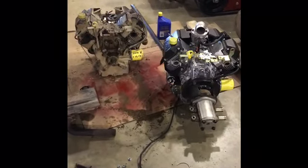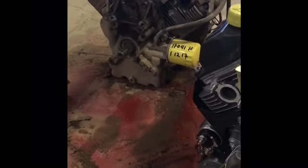On the old engine first, find where the drain plug is for the oil drain and unscrew it. On the same side of the new engine, find the bolt in the place where that drain goes, take that bolt out, and replace it with the oil drain from the old engine. We use a liquid gasket before installing it to prevent any oil leakage from seeping out between the metal parts.